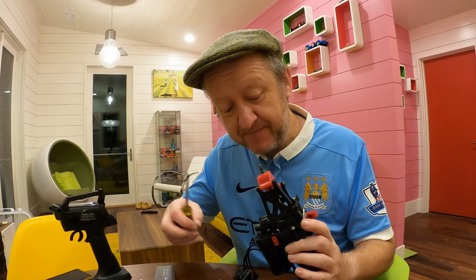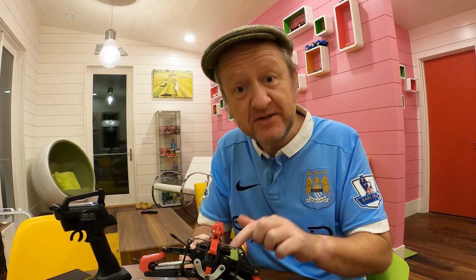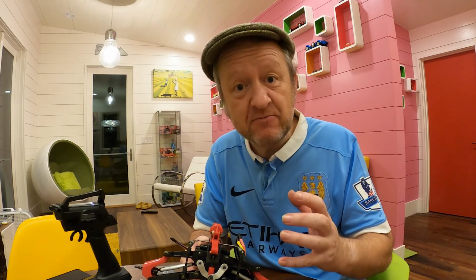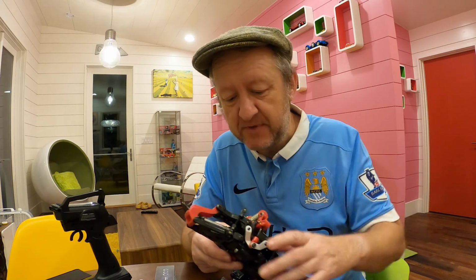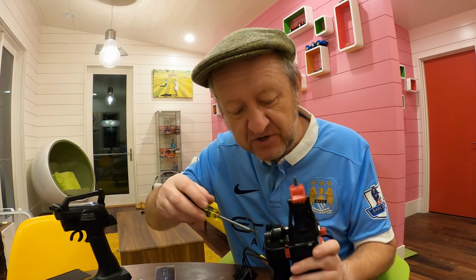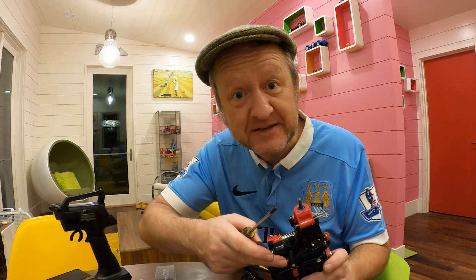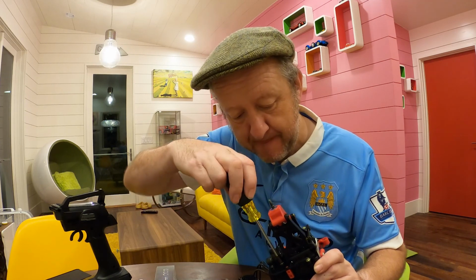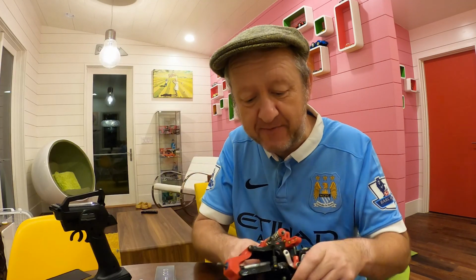So this is quite a tricky operation. I am adjusting the motor into the hotshot so that the pinion gear will easily rotate the gears of the transmission here, on the rear transmission. And you do this by adjusting these two screws here. I had to put a little spacer on this one in order to make it work, but I'm just going to tighten them up here. There you go. Make sure you tighten them up real good, because otherwise the wheels would chew each other inside there. We don't want that.